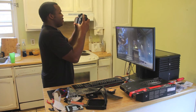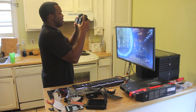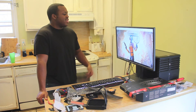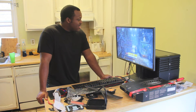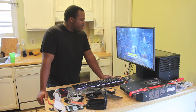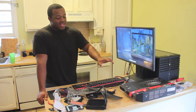As you can see — 1257 MHz, 1267 MHz. This is close to the regular stock 1266, so it's not at all getting close to 1328. That may be due to power limits, so I'm going to toggle with that and see how well it does. We're all the way up to 73 degrees Celsius right now and this thing does not sound good. 73 is acceptable — the card is ready to go all the way up to 90 degrees — but listen to how loud it already is. The fan is apparently up to 3762 RPMs, 78% of its usage already. That's going to be a problem if we're not able to keep it cool enough to even get it to the stock 1328, which is the issue I ran into with the card to begin with and why I'm doing this mod in the first place. It can't even hold the 1328 without turning the fan profile up to a ridiculous speed.